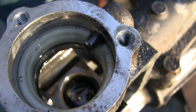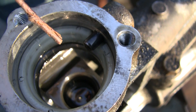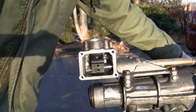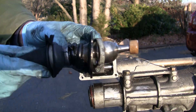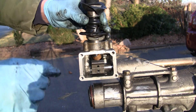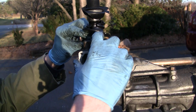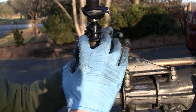Looking into the top of the transmission where the shifter goes, you'll notice a tiny pin that fits that slot, a little ring slightly larger than the one on the shifter, and a round hole at the bottom where the bushing fits. To install the shifter, you line up the slot with that pin, make sure the bushing is straight so it pops in, and once those two conditions are met it sits right in. Then the boot goes on and three screws hold it in place.